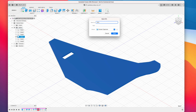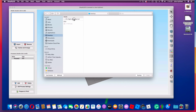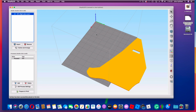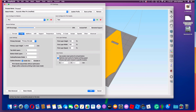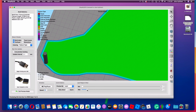This is for the next software, which is the slicer. The slicer takes the model and makes the file that the 3D printer understands. In this software, I make adjustments to the printing process, for example how many solid layers I want to have, and also temperatures and other parameters. Then I can save the file to a memory card.